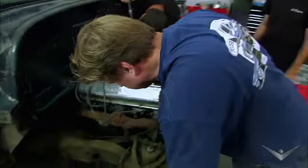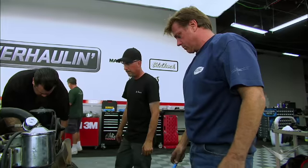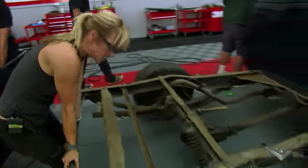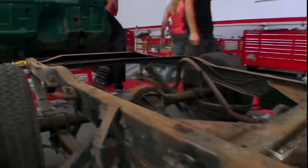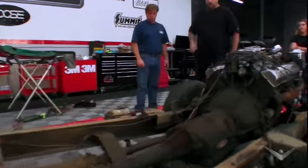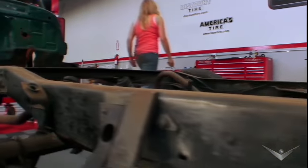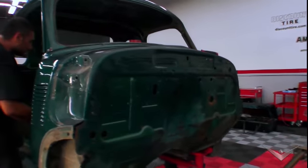I think this is the whole Cadillac front clip — it may or may not potentially be an issue depending upon how well their fab work was. The truck frame here has revealed a rough and old frame mod that might not be repairable. This is not great news because the modifications on the original frame won't work with the suspension upgrades that we have planned.